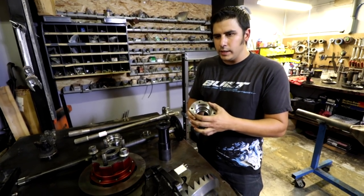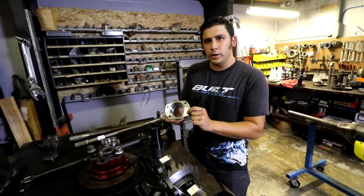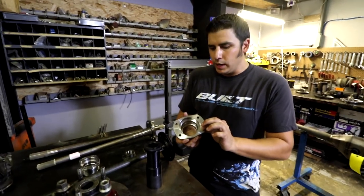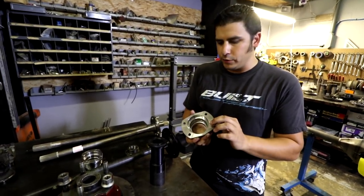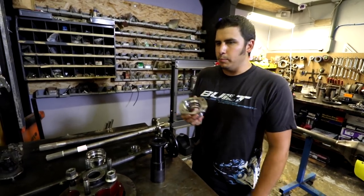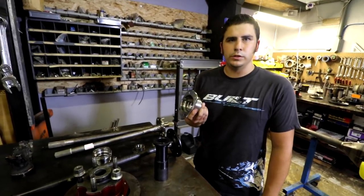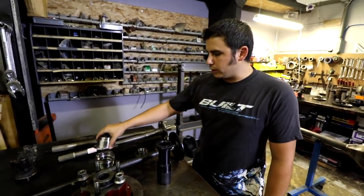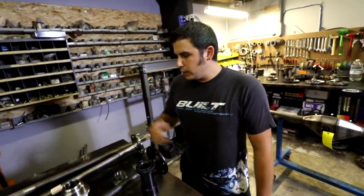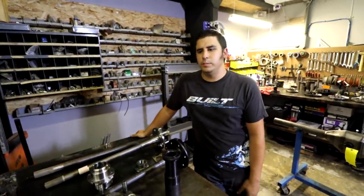And also they make a new style and an old style. So the new style will have that diameter with the 3/8 hardware, and the other big bearing housing will have actually half inch bolts, which is one way to tell that it's a big bearing, is the half inch bolts. This end and this bearing combo is going to have the most brake kit options and other aftermarket accessories, because it's the most common go-to for the aftermarket stuff. So make sure you get the big bearing 9-inch if you're going to try. Yeah, which will be out of a van or the Torinos and the big cars and stuff.